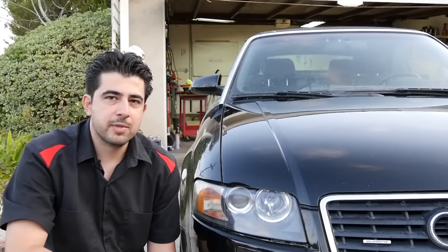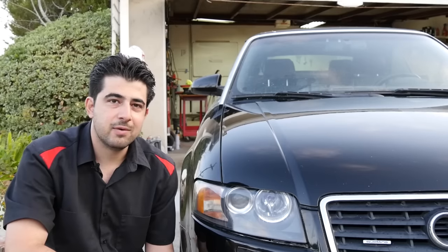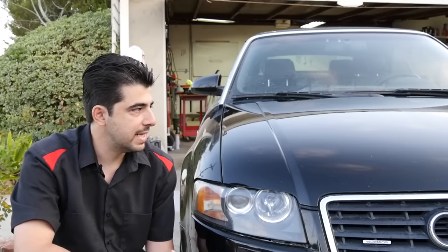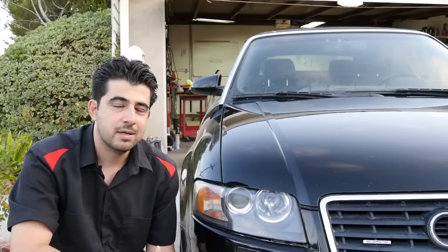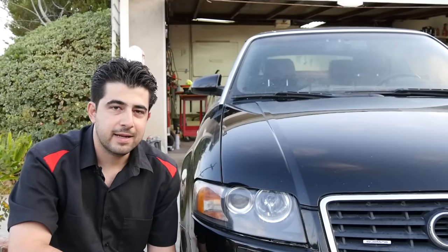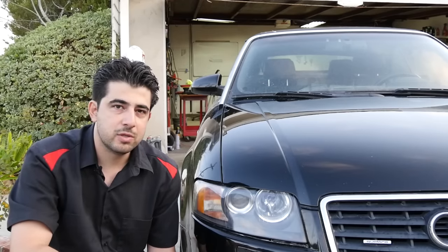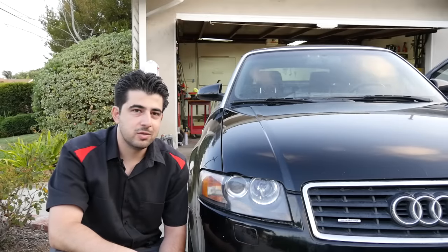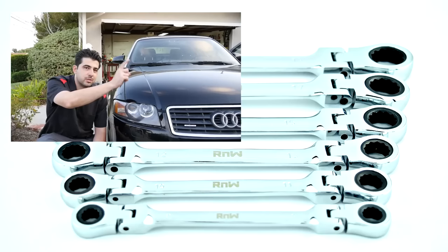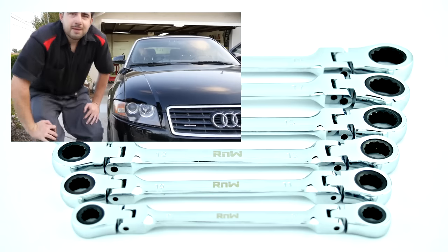So there you have it folks — we were able to do a lot with just compounding and polishing. Now there's even more you can do to rejuvenate old clear coat. For example, we could have wet sanded this clear coat and then compounded, then polished, and then after that used a swirl remover, and then used some wax to really bring out the shine. But it all depends on what you want to do and what the final product you want to have. Now if you want to learn how to do those things plus more, I suggest you watch these videos, links on this side of the screen and down below in the description box as well. Thanks for watching, I'll see you guys next time.